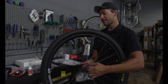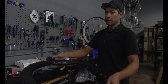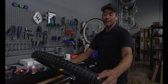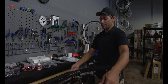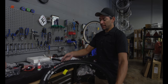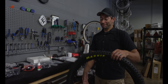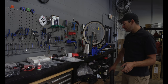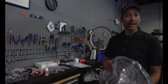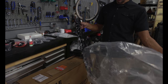Your tires are going to be part of your suspension system. So I typically like to tell people, as you ride, you can feel the tire collapse and hit the rim maybe once per lap. If you hit the rim or bottom out your tire more than that, that's problematic. But you can use all that suspension. I don't foresee any issue with the sealant setup. But for me to bottom out, I'm going to have to drop 10 feet on this thing. Well, with a tire, if you're supposed to be riding it at 32 and you're a heavier rider, and then you drop it down to 25, you may bottom out that tire more easily. But experiment with it.